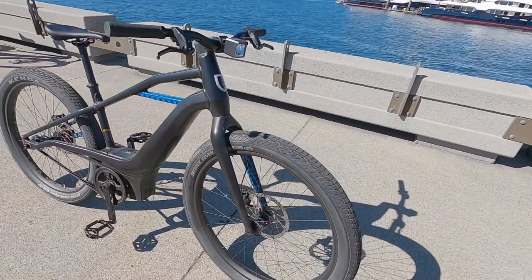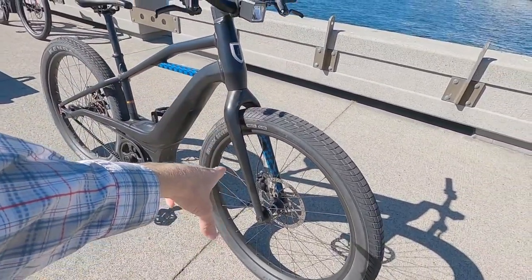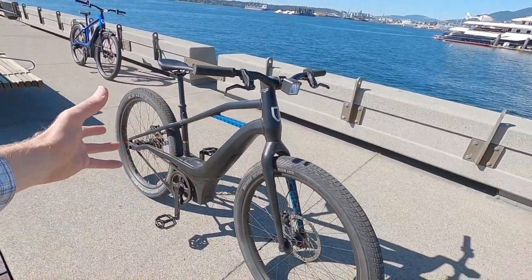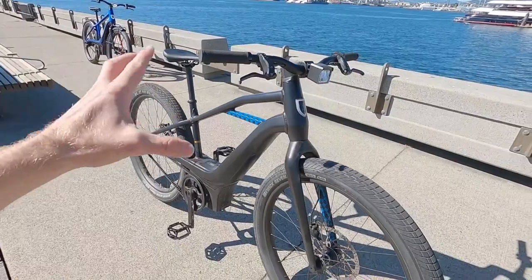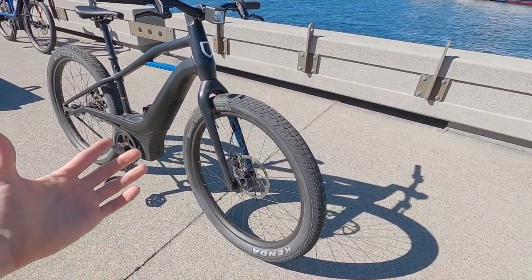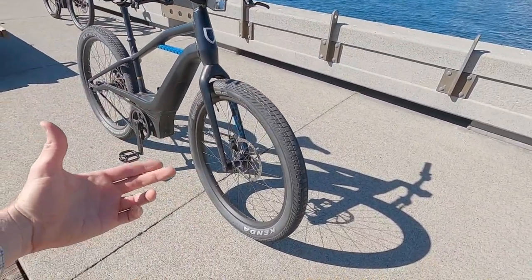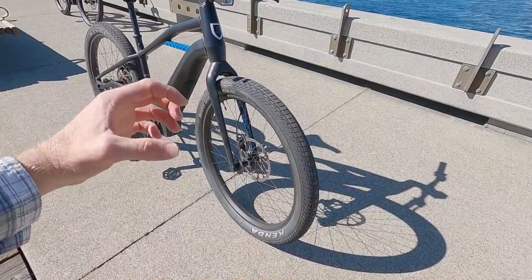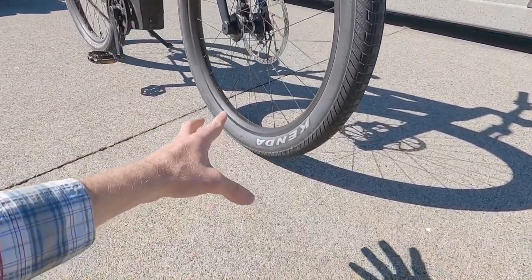Getting into the components, I love the bigger tires. As you can see, this is a rigid frame with a rigid fork — all aluminum alloy, very nicely done, hydroformed, with extra support bars and gussets so it feels very sturdy. These higher volume tires are 27.5 by 2.8 — plus size — which increases air volume, gives you more comfort, and dampens vibration.